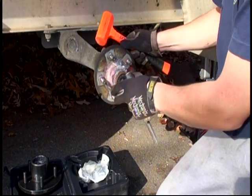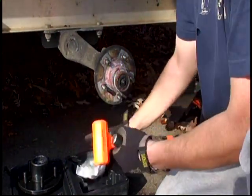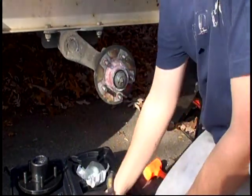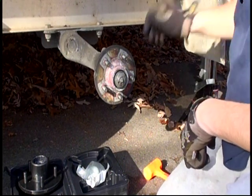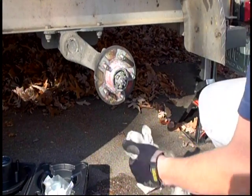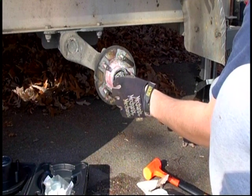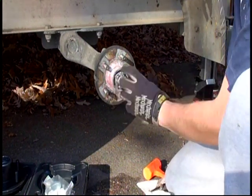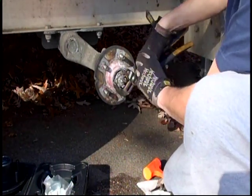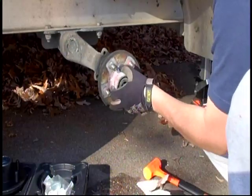If you want to be careful with these to get them off so you can reuse them, that's fine, but the kit does come with a new dust cover. Let's go ahead and pop this off and see what we got. From here out, just the same way you would go ahead and change your bearings. Once you get your cover off, just take a rag or paper towel and go ahead and get your grease off so you can see what you got. This is a slightly newer style which doesn't use a cotter pin, just a little tab you bend down. Some have washers with tabs you bend down. Just go ahead and bend those down and take the castle nut off.